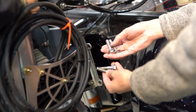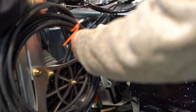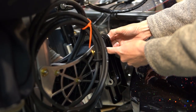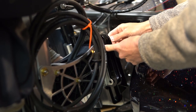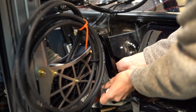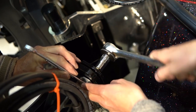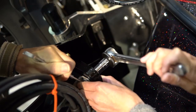Take the shorter bolts — the longer short ones go through the hole on the side closest to the edge of the boat, farthest from the engine, because you need a little more length to get through both brackets. Put both in, then add the washer on the other side and the brass nylock nut. Get it a little tightened, then stick the other bolt through the hole. That's why you didn't tighten the bracket too much — you want to be able to move it around. Once you have all four bolts in, have somebody hold a nine-sixteenths wrench on that side and tighten them down almost all the way, leaving a little wiggle room.